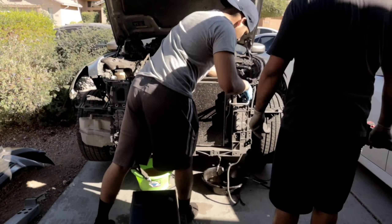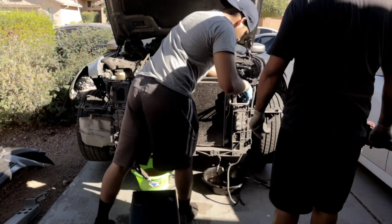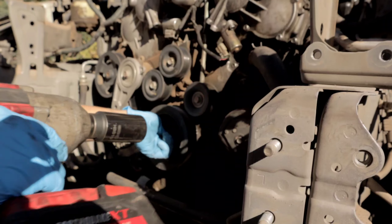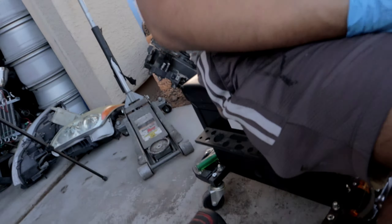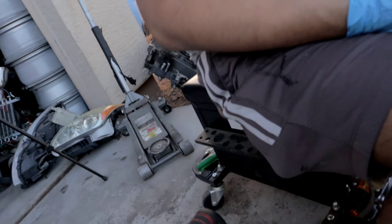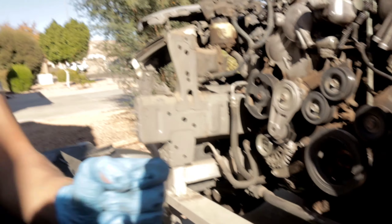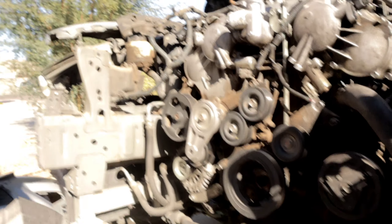In this part of the video I accidentally forgot to turn on the microphone, but basically what we were doing here is removing the crankshaft bolt. This is a 19 millimeter and I'm using a special 19 millimeter socket to remove this bolt — I'll leave it in the description so that you guys can purchase it. Without this tool it's basically gonna be impossible to remove this 19 millimeter fastener. As you guys can tell it's a lot fatter and bulkier than your standard 19 millimeter socket, and you do have to use this to get this out. I was using a regular half-inch electric impact to remove it. Once you do this your pulley should come free.